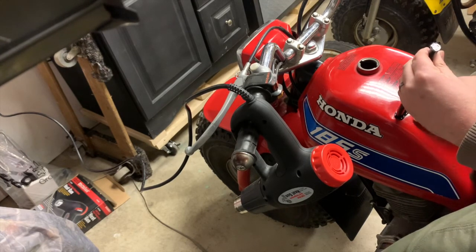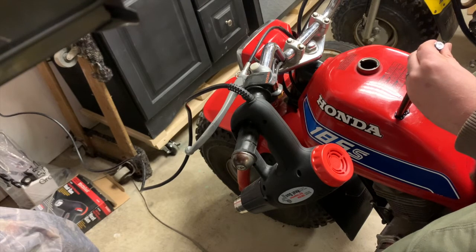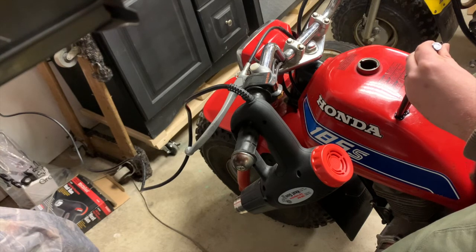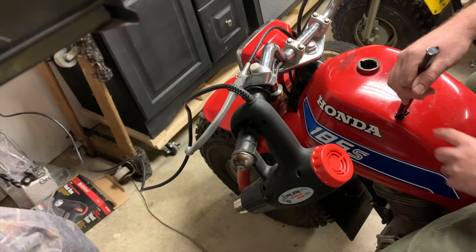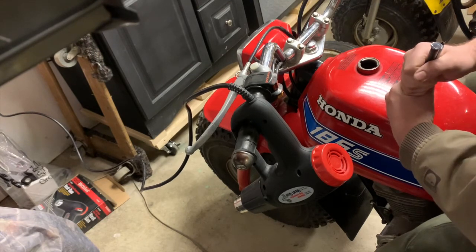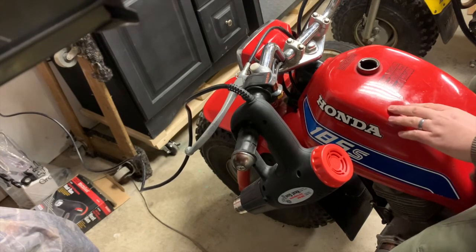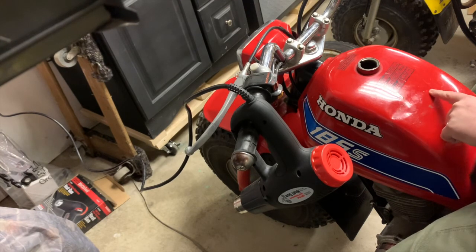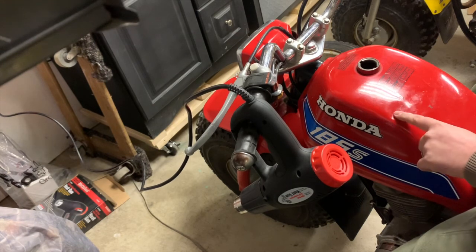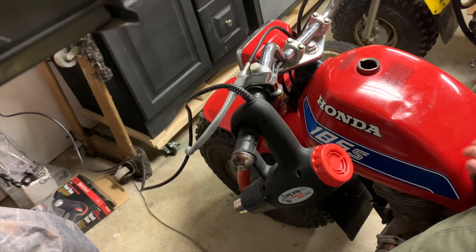Still a little bit of heat left, so I'll just let these set up and pull. This area right here is definitely the deepest part of the dent. I'm going to try to work over here a little bit more. Not making a lot of headway here — being right on this ridge of the tank, this is pretty tough metal and is going to be tough to move. But it's looking so much better.